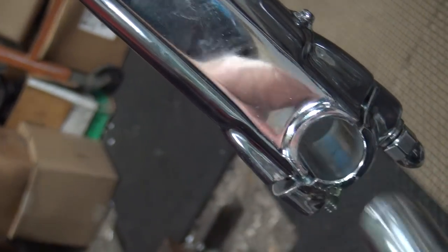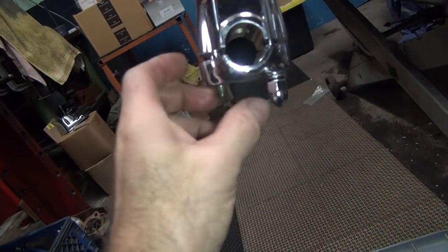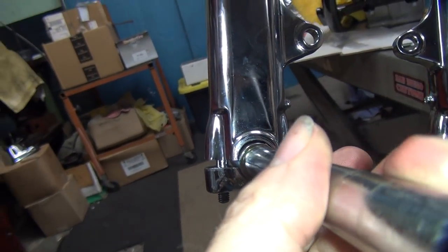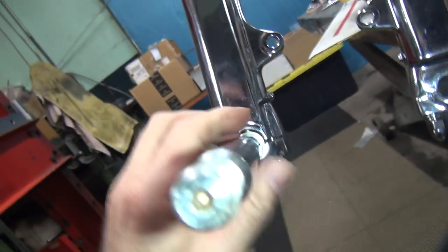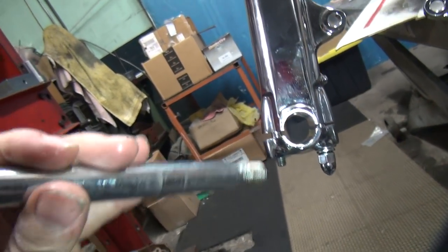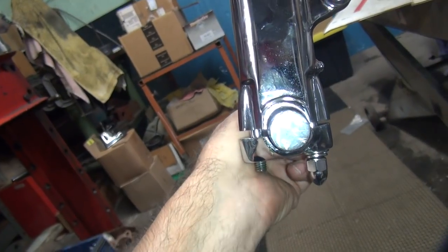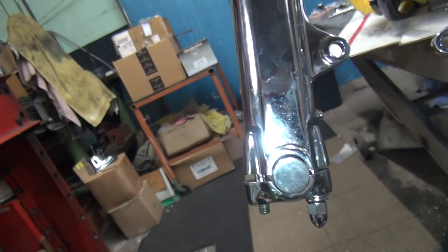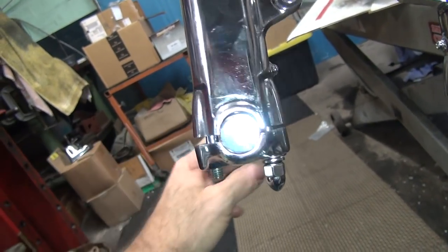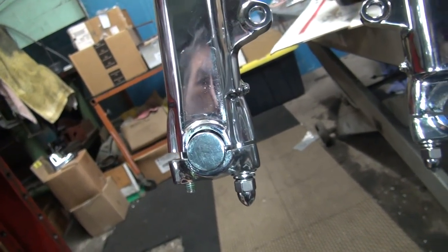So, it's called heavy chrome buildup. So the cap is all right. That fits, it's just the top part of the slider doesn't. And of course, that's not something we check before we put the whole thing together because you don't expect it to be a problem. So, we have two options. Cut the axle down or cut the fork to fit like it should fit. Both require cutting chrome.